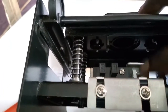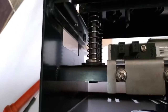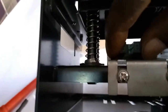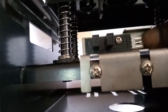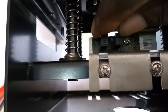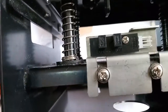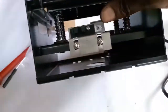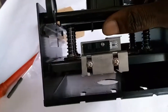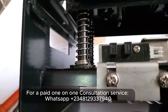But the capping station is prone to one or two errors. The first error that is common with the capping station is when you have a problem with this sensor right here. When your machine gives you a cap error, the error basically comes from when you either have an issue with this sensor — whether it is not connected properly by a cable, or maybe you have a large splash of ink on top of it and it has damaged the chemical on the inside.